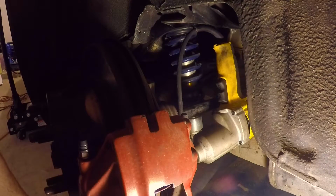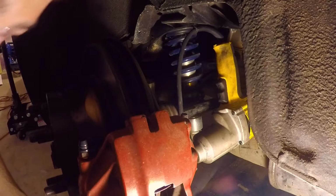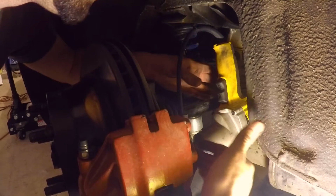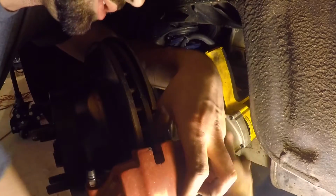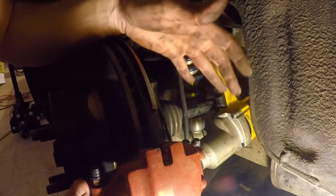We're at the rear of the vehicle working on the rear calipers. Same thing applies. Drop the trap door down, spread the pads apart, pull the pads out. Where it is different is the caliper bolts are different. They're actually a 19mm bolt, and they're on pretty tight, so I'm using an impact. I've got it positioned, and that's really the only way to bust them loose that I found, unless you have a breaker bar, which I don't think you could even get back here. So I wanted to show you guys that. I hope you find that helpful.